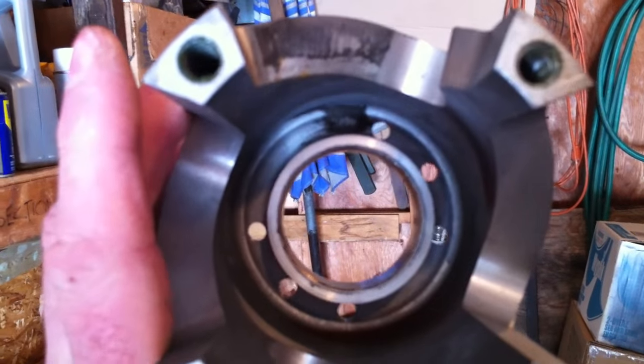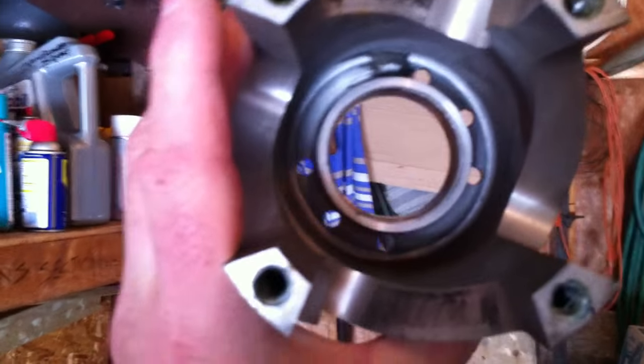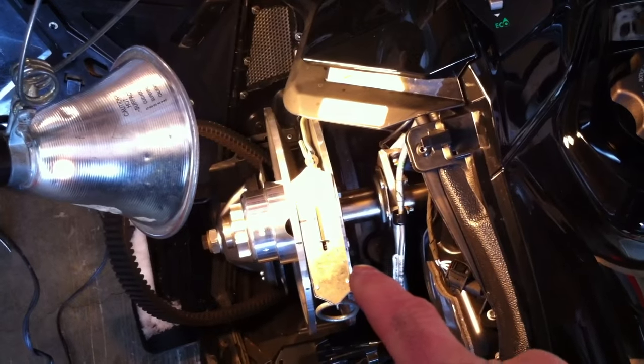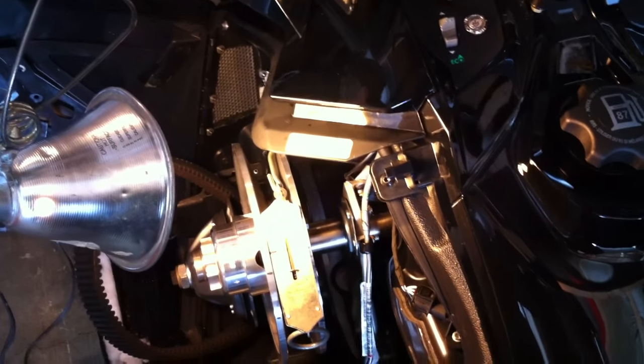And then on the back side, you can see that the one hole was being used because of where the spring left a little bit of a black mark there. But then you've got all those other spots where you can get different pressures. So you just got to play around with it. And the nice thing is you use your fish scale. Every time you use your fish scale, you know if you're getting stiffer or less stiff. And that's really what you want to play around with.